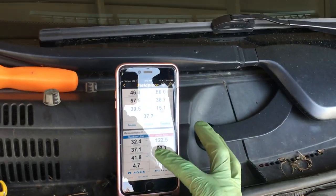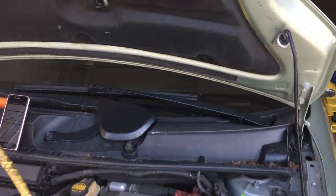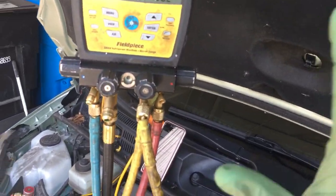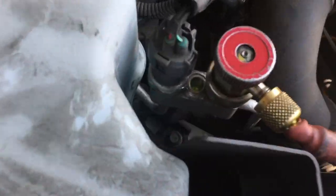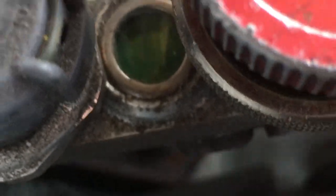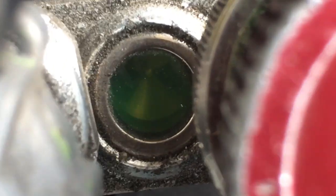These are the running pressures and readings under these conditions. It's in the shade so there's no sun load, and it's a mild day. Another thing — your sight glass should be crystal clear. When you see a sight glass, there should be no fogginess or fuzziness to it. Let's see if I can focus down into the sight glass.